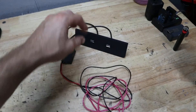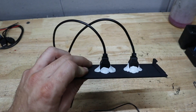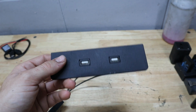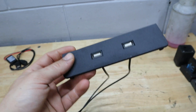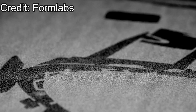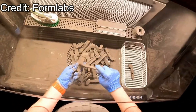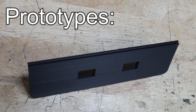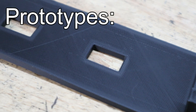So here's my solution — it's a rear center console USB retrofit, made up of a couple of different parts. It is hand assembled; you can see there's epoxy on the back there. The front plate is 3D printed using a technology called SLS 3D printing. They don't use filament like standard 3D printing. Instead, there's a chamber that holds what I call moon dust and a laser that comes and melts it into shapes layer by layer, creating objects out of that dust. It doesn't have any markings that would indicate it's 3D printed, whereas a standard 3D printed object clearly shows the print path and has a cheaper feel.